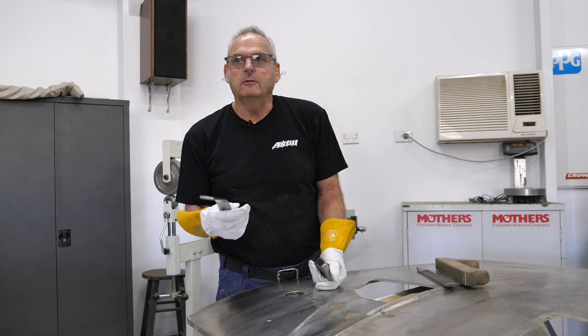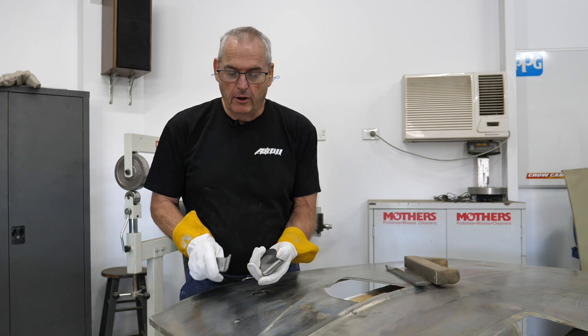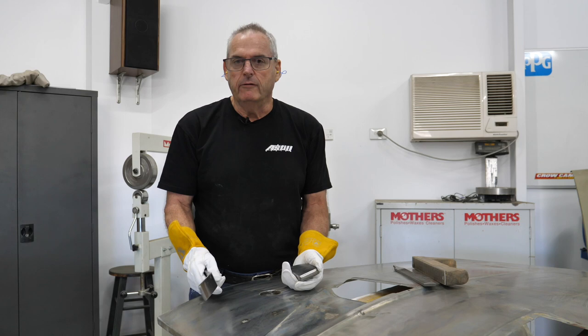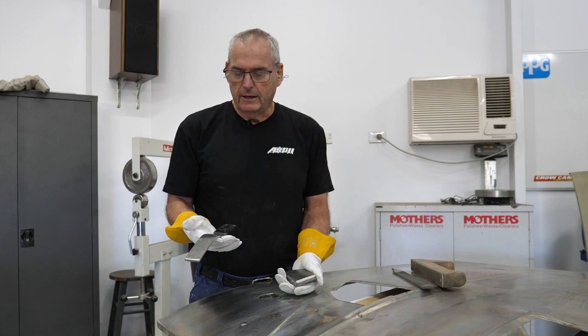This is mild steel from a bit of angle iron that was probably 40 years old with BHP stamped on it - probably good quality steel from back in the day. I just like the weight. It's a fairly wide area and it's low so I'm going to need to push it up, probably use the curved back of the dolly but also turn it over and use the flat. I prefer this flipper over a hammer because with a hammer you tend to leave hammer marks, whereas over a larger area you don't get as much marking.